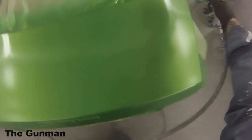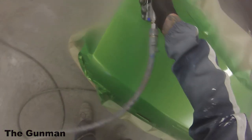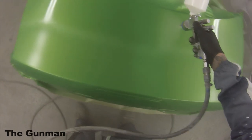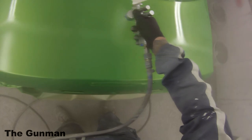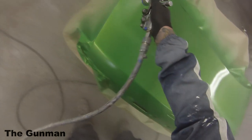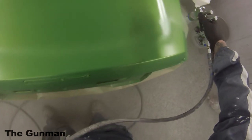There's places around that do it. You've also got environmental, health and safety issues. I wouldn't like my next door neighbor spraying 2-pack paint while my kids are running around in the backyard. It's not healthy. Paint is also highly flammable, so you've got to be very careful of any ignition sources.